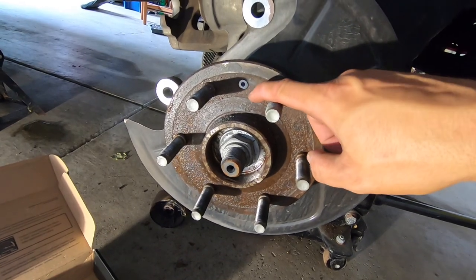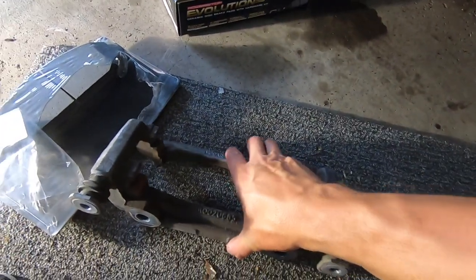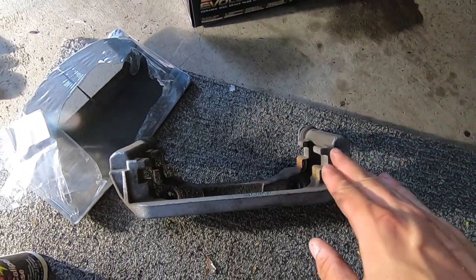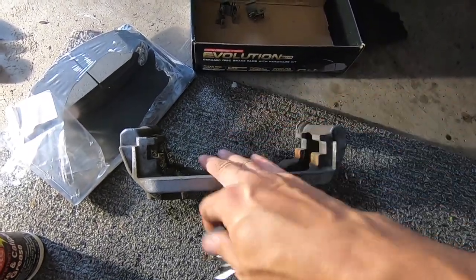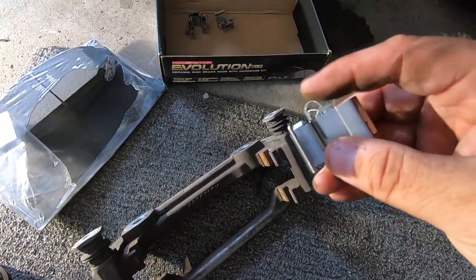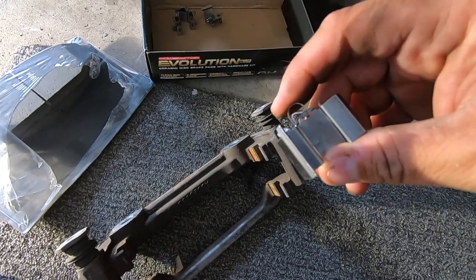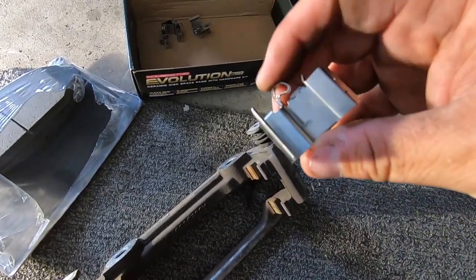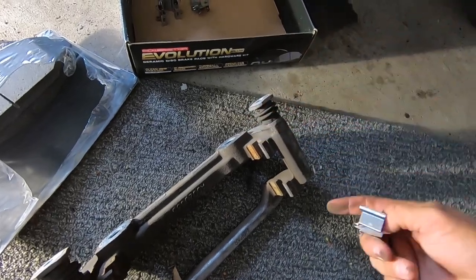We are cleaned up there - you can see what's left of that screw, it's in there but it's nice and flat. I went ahead and pulled off those clips - those are what help the brake pads slide in and out. They're spring-loaded, so they push the pad up against the rotor. Unlike some cars, there are four pieces to each caliper bracket. Make sure when you're clipping these in, this little rounded part is on the outboard side of the caliper bracket - pointing towards the outside, not towards the rotor.